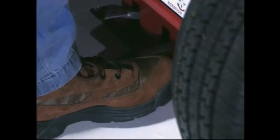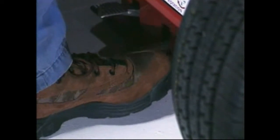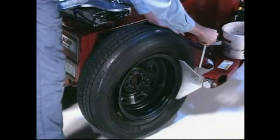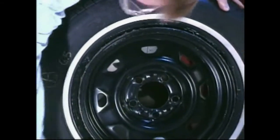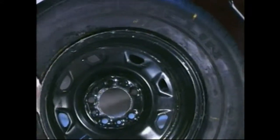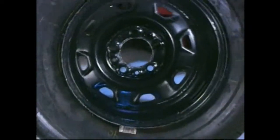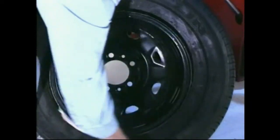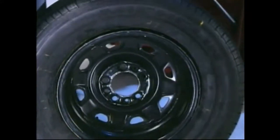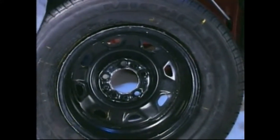Feathering the pedal gives you more control to prevent tire and rim damage, and a light grip from one side prevents shock to your hand if the loosener moves suddenly. Generously lubricate both tire beads using tire manufacturer approved rubber lubricant. The importance of using tire lubricant cannot be overemphasized. Its use greatly reduces the chance of damage to the bead or rim and makes tire installation or removal easier, faster and safer.